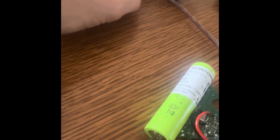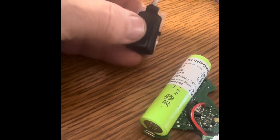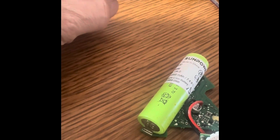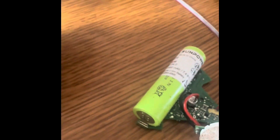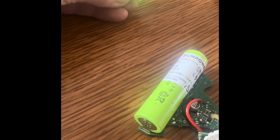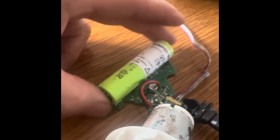The system now knows there's enough voltage to start recharging, and at that point you can disconnect the parallel battery and the system continues to charge on its own. This is a big problem with lithium-ion batteries — if they get down past a certain voltage they might still be fine physically, but you can't recharge them normally. You have to trick the system by putting another battery in parallel to raise the voltage, then once it starts charging you're good to go.